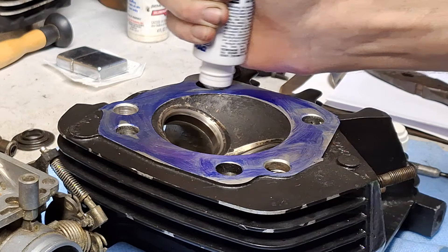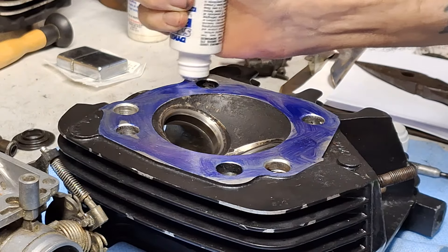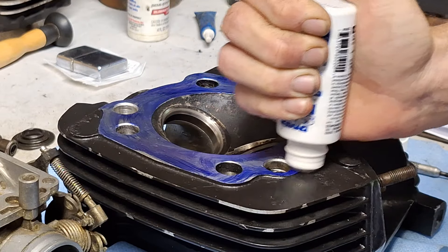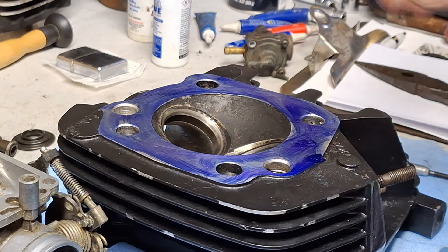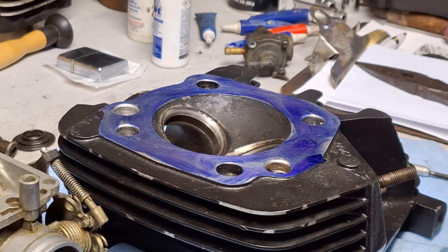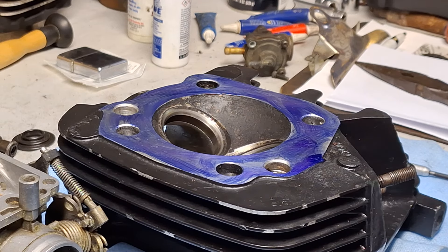I don't think I'll be buying this again, at least not this roller tip thing. I like to be able to paint it on there, but this is what I got, so we're just going to put some bluing on there. It's strong. Give it a couple of seconds to dry, and all we're doing here is checking the edge of the cylinder head where the gasket goes, to make sure that I don't actually cut into the head past the head gasket fire ring when I'm working on this head.